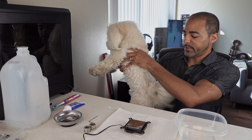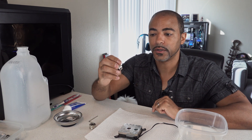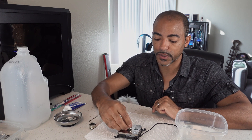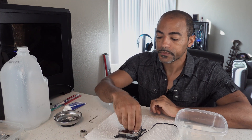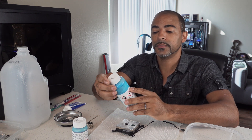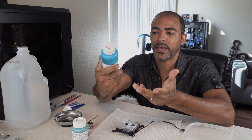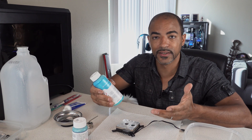I'm going to try to do this with Louie in my lap apparently. A water block can actually fit different size fittings — these are by EKWB as well. These are 16mm outer diameter for hardline tubing and they just screw in, then I can put all my tubes and design the system the way I want. We need to open this up because I can already see there's a blue stain in here. I've used two different types of fluid: the EK Cryofuel Solid Azure Blue, which I really like the color of but it is thick — it's basically a pastel concentrate — and it takes a lot more work to clean.